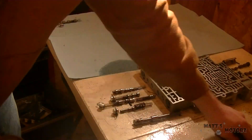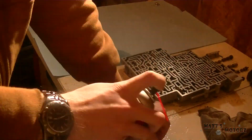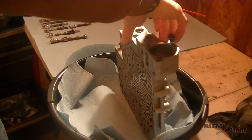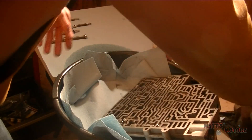I'm just going to go through fast motion here. I'm going to clean all the valves and the valve body. I'm using brake clean there — just make sure you use something that doesn't leave a residue. That's very important. This specifically says it does not, and I've used this before and it's been fine.